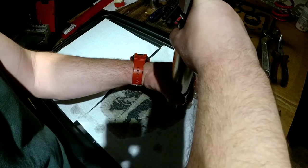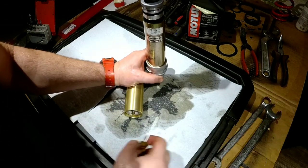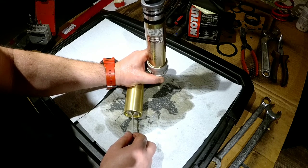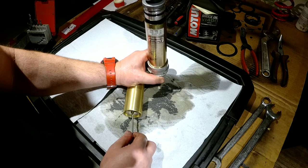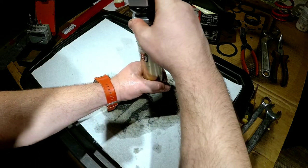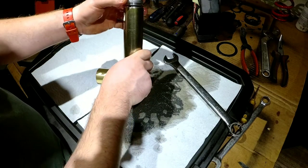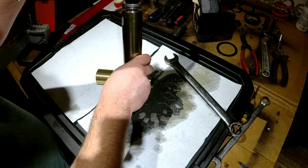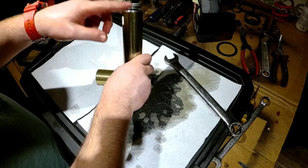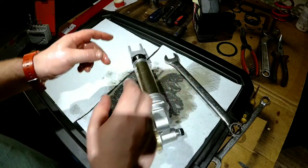What we're gonna do is, okay, let's release the air. We're gonna add some oil and close the shock. Okay, let me just check something before I close the shock. I'm not sure right now, do I have the shaft in the maximum upper position, for maximum volume of fluid, or do I just want to have it down with the plug in at the bottom of the shaft? So let me just double check that and I'll be back.